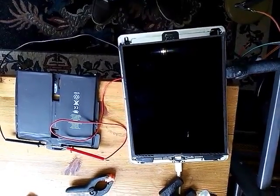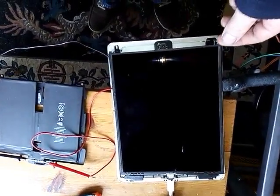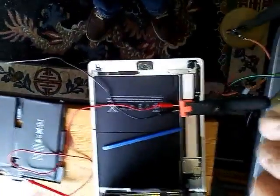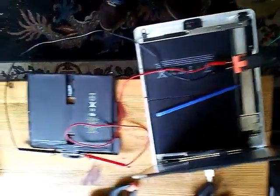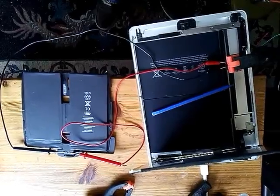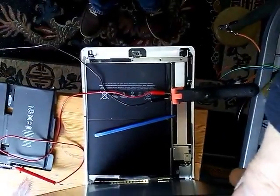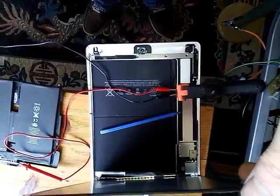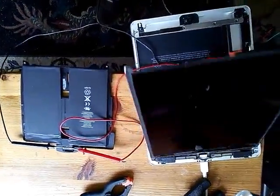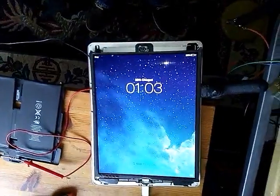I can get anything in the iPad out of it, so what I've done is I've moved it down to the board where the battery is, and I've connected the connectors there to an iPad 1 battery that I had — it's the same voltage. I've jumped it basically; the connector pushes from the logic board down onto the battery, so I've connected the positive and negative to the iPad 1 battery, which means I can actually turn the iPad on.